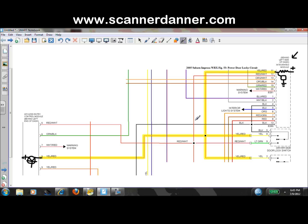For circuit identification using a wiring diagram, looking at the wire that goes to the computer never tells you what it is, because they don't draw the stuff I drew here. This stuff does not exist on these diagrams. All you have is a wire going to a computer. What is it? What's its design? You don't know by looking at the signal wire. You follow the wire that does not go to the computer, and in our case, if you remember, this splice ended up going to a ground. So it is a pull down design for sure.